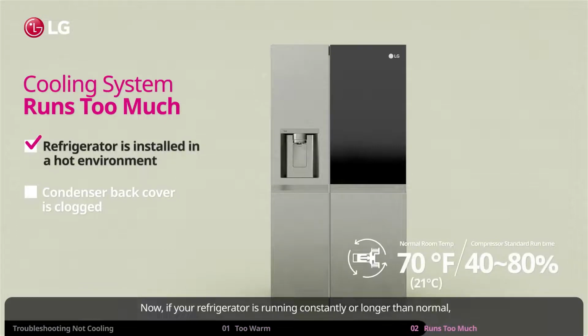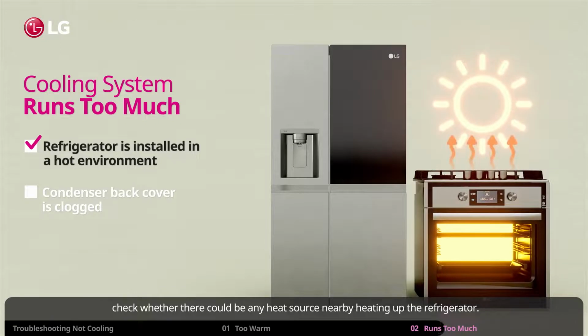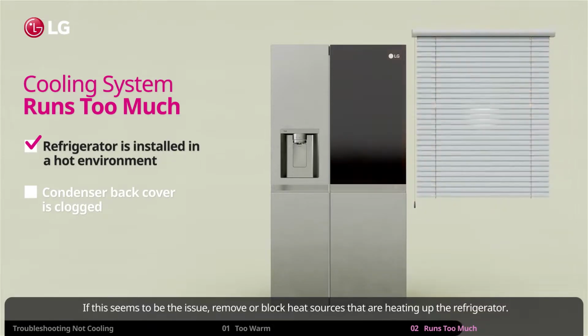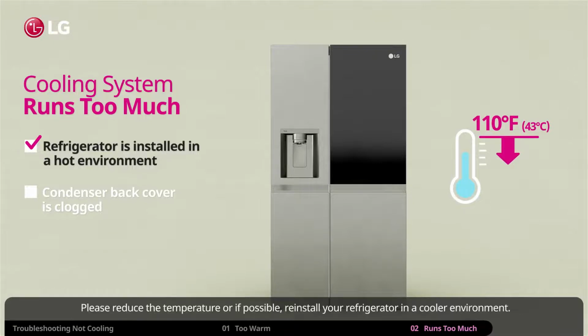Now, if your refrigerator is running constantly or longer than normal, check whether there could be any heat source nearby heating up the refrigerator. If this seems to be the issue, remove or block heat sources that are heating up the refrigerator. Also, the ambient room temperature itself should not exceed 110 degrees Fahrenheit, 43 degrees Celsius. Please reduce the temperature or, if possible, reinstall your refrigerator in a cooler environment.